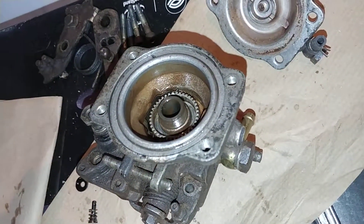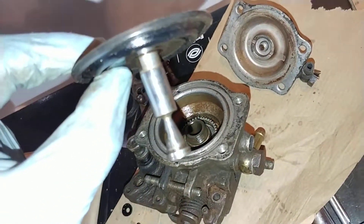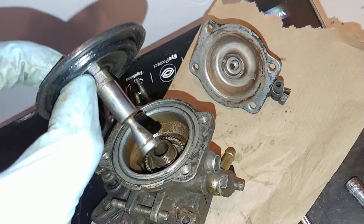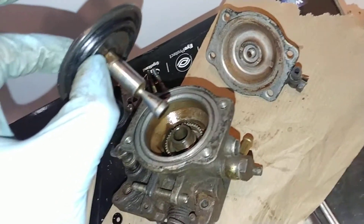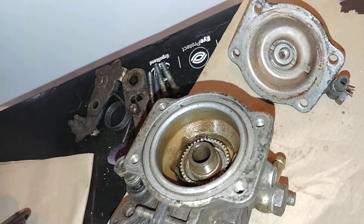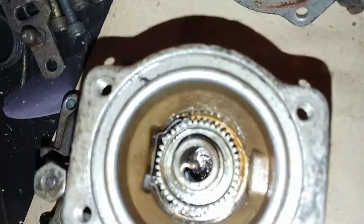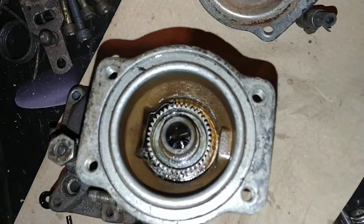Another question I had when messing with this: you can buy different versions of these. When I first saw that I thought, why would I go spend money on a new one with a different profile when you can just use the most aggressive ramp right on here? But I wondered: can you actually get more maximum fuel by purchasing those other ones, or is it kind of a gimmick? There is a legitimate mechanical reason why buying one of those could increase your max fuel, and I'll show you why. Right now this will not go all the way in because that little sliding mechanism down there is all the way in.